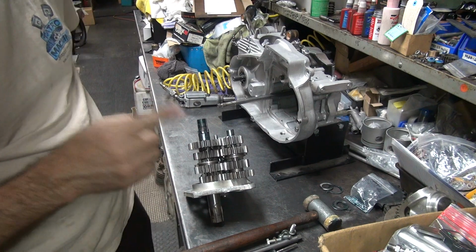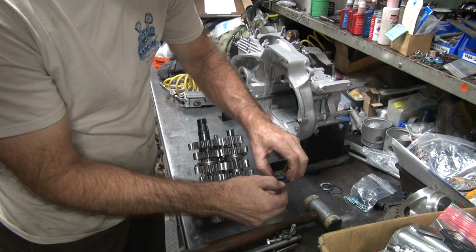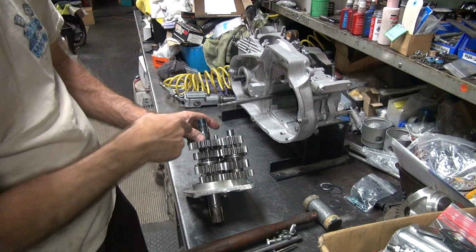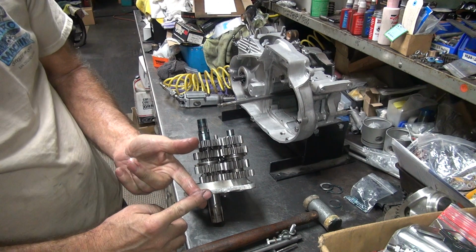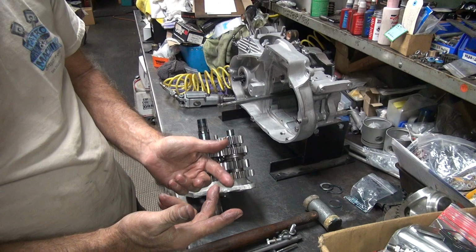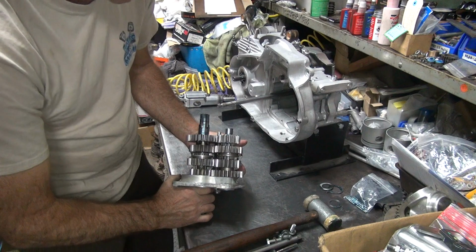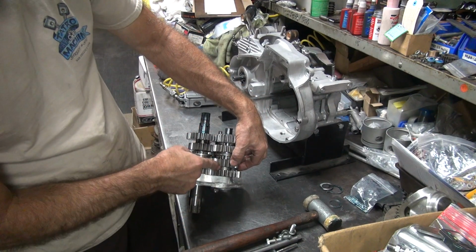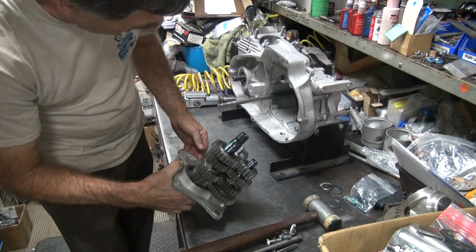Just a hot rod bike, so give a little extra. Okay, we had 15 we took out. I'm going to put the old one back in on this one. That's the original one going back in. We were at least negative 5, so at least 5 off. We want 10, that's 15 out. That's pushing it. Now the reason I took an extra one out of the counter shaft is because remember this gear here is pretty tight. If that loosens up a little bit, it'll come out of this other side. So that's why I gave it a little extra.